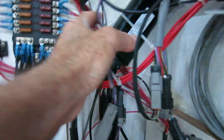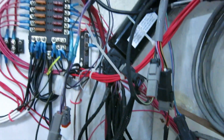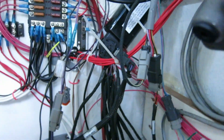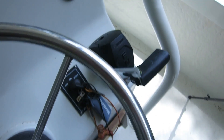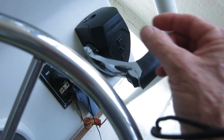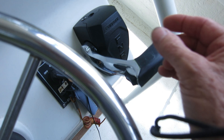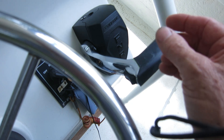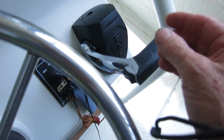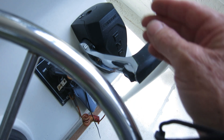The shifter — or the computer — is back in place. I got the big harness plugged into the bottom and the tilt plug plugged in. I think if I go turn on the battery switch for the outboard I should have power. So another roadblock: even though the circuit board doesn't physically touch the shifter, the magnet at the end of the shaft that operates the proximity switch on the circuit board is in a different position on this one compared to the other one. If I took the shift handle off and turned it almost 180 degrees it would let the engine start up, but then the throttle and shift wouldn't work. More issues. So I'm punting again and going to bring it to the dealer and cross my fingers that he can make this older-version shifter work with my newer-version motor.